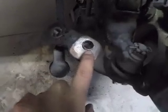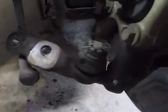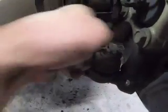Here is that 17 millimeter bolt — take that one off, then go ahead and take off the second one located under here. 17 millimeters, lefty loosey righty tighty. You can just push it off to the right — it should be fine to dangle there for a few minutes until you take off the lower ball joint.